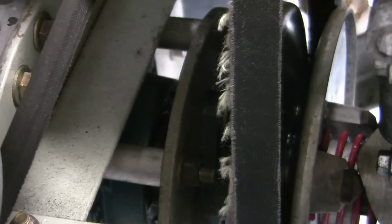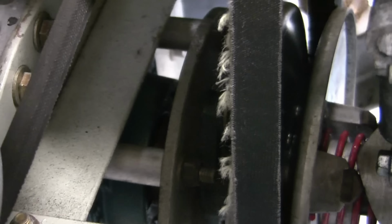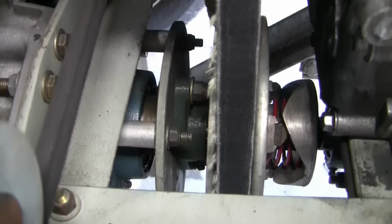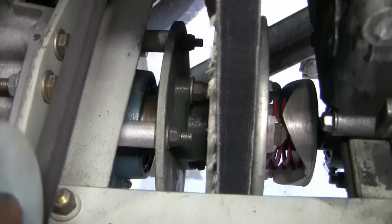We've been using this type of CVT drive for a while now, and normally we see an accumulation of black powdered dust around the drive system as the belt wears. And currently we're not seeing the telltale signs of normal belt wear. So this fraying of the cords is somewhat alarming, even though we're fully aware that the belt's not rated for the power we're transmitting through it.